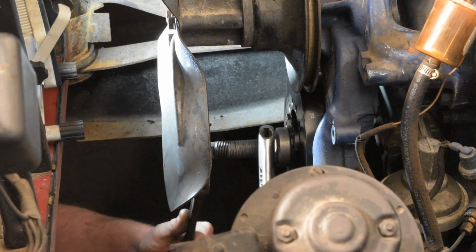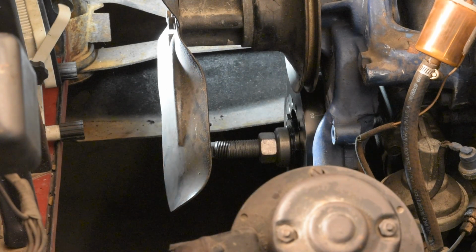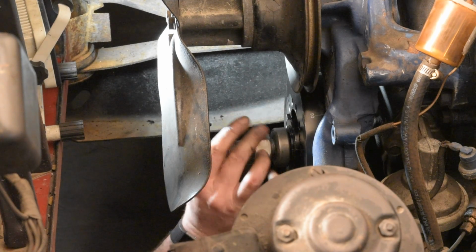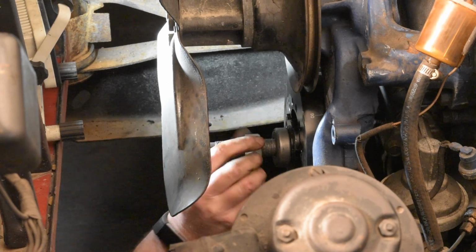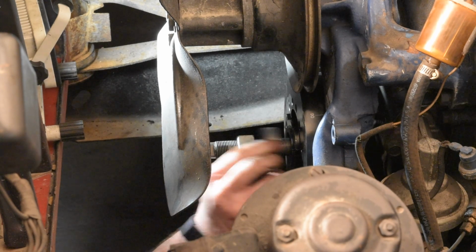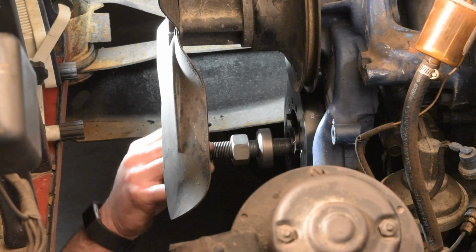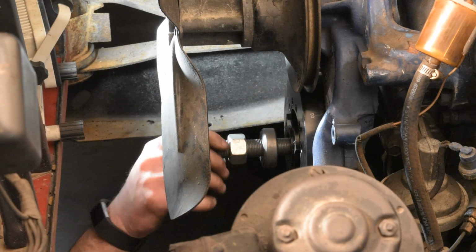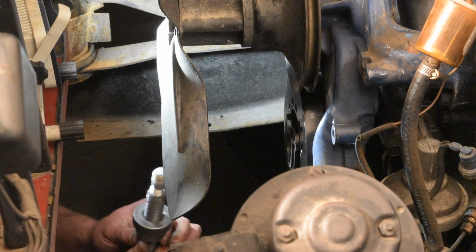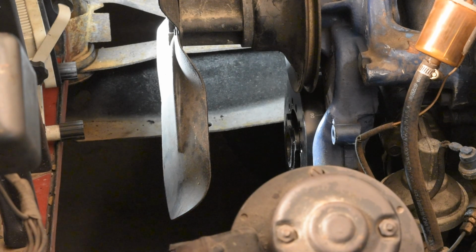Double check. Now we'll loosen the puller. As I loosen this, you'll see how it threads on. So you got your center shaft here, you got a nut here, you got a bearing right there. So here's your center shaft, here's your jam nut, here's your bearing. This guy should thread out. Hopefully what was in the engine comes out with this, because there's no hex or anything on it. There we go. So here's your center that, we got different sizes in the kit that thread into the crankshaft.